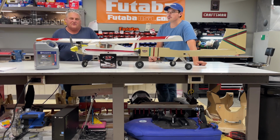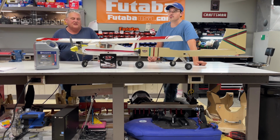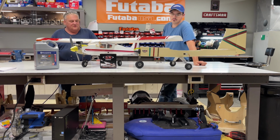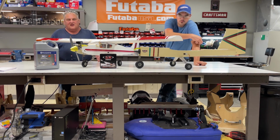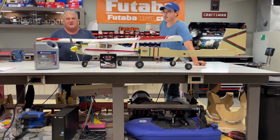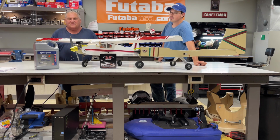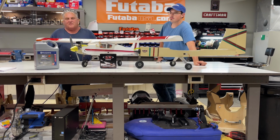It's an FD certified oil from the JASO, which is the Japanese Automotive Standards Organization. Their standards are much higher than the American Petroleum Institute. If you go online and you actually see how they tested this oil, and you see the computerized equipment and how they put chainsaws in chambers that are minus 20 degrees, and they run them through vigorous testing. If you watch that testing, this isn't Uncle Bob's garage where he's telling you this is the best oil. They're showing you why it's the best oil. It's a verified product by Husqvarna.